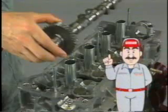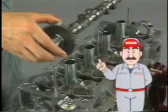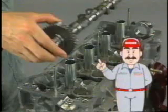Now the camshafts have been removed. During these procedures, be careful not to apply excessive force to the camshafts or damage the thrust portion on the cylinder head side with a tool or other object. This could cause problems such as camshaft seizure or breakage after the engine is reassembled.